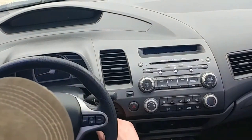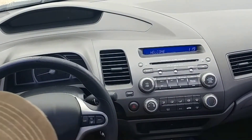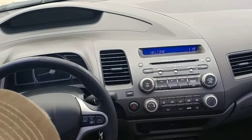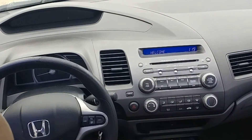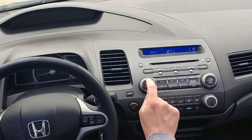From this point, you want to turn your radio off — power is off on the radio. Now, with one hand, you want to press both buttons — the tune/folder button and your power button at the same time. That allows you to adjust and change the welcome message.